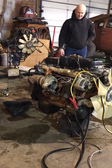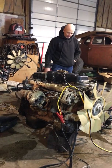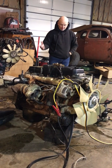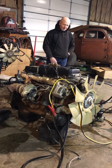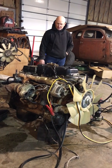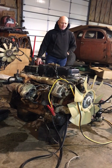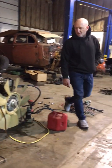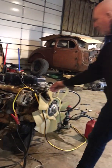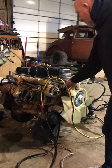So basically one wire to the ECM on the block and your hot wire to your starter, a couple grounds to the block, and one main ground to the block — that's it. And the ECM's grounded obviously to the block. So pretty exciting. Basically made my own standalone harness. The jumper cable I'm just using for an extra ground so I don't have a grounding issue — that's all the jumper cable is for. See y'all later.